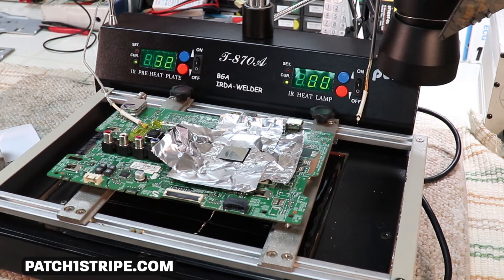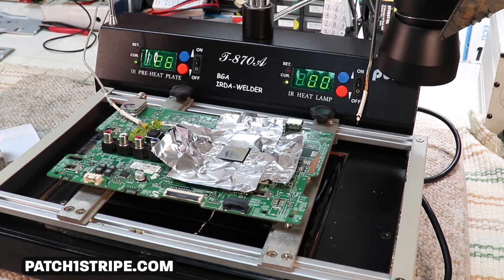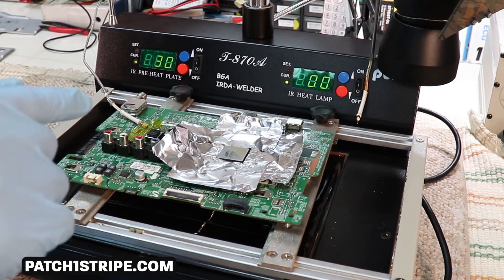The duration of time I basically use my own discretion to try to make something happen. Lately I've even added some flux to the sides of the BGA before reflowing, and I had a hundred percent success — that particular unit has been playing now for about eight to nine days straight without shutting off. I had an intermittent problem where it would play for a while then shut down. But like I said, you can have the same issue when it just won't start up — it may be the BGA, especially if you've narrowed it down to something on the main board.